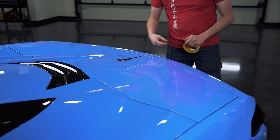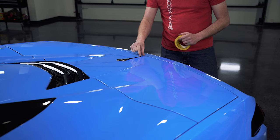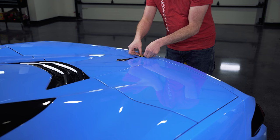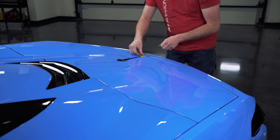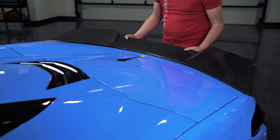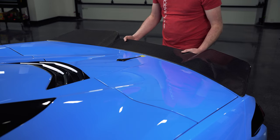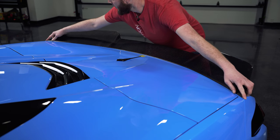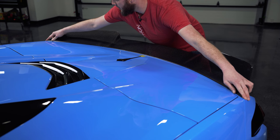I'm going to apply a small piece of tape here in the center. Don't make it too big of a piece of tape, so that way it doesn't get in the way of installing the spoiler. We're going to take the spoiler and just set it gently on the car here. We're going to dry fit it without peeling any of the double-sided tape. Then, using your fingers on the ends, just try to center the spoiler with the bumper.